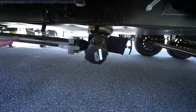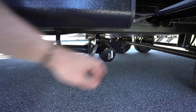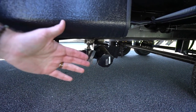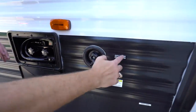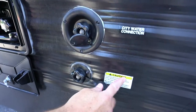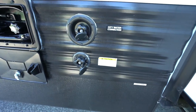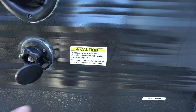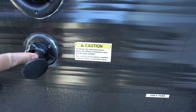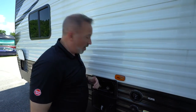For your terminations, when you hook up at camp try to keep the tanks closed because you want some water in there, especially in your black tank. The gray handle is the gray tank, the black handle is the black tank. When dumping, dump the black first, then the gray so it washes out. The city water connection and black tank flush are usually labeled. When doing the black tank flush, make sure the termination valve is in the open position — meaning you've pulled it out — because if you try to flush the black tank while it's closed, the water will go somewhere you don't want.